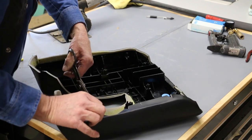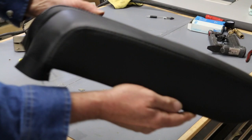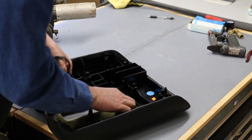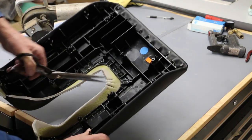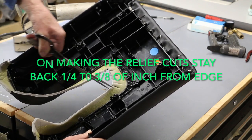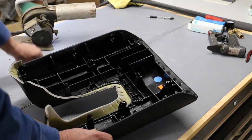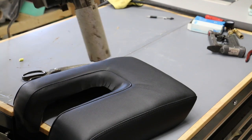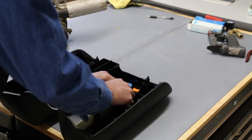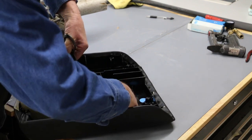There's that edge — you can see it. It's all double-seamed. Now we're going to focus on the center. I'm staying back three-eighths of an inch. Stay back from that edge three-quarters of an inch — make your relief cuts. Now I'm going to take that heat gun and gently heat it up here. I start in the corner — take your finger and push the glue in there. Come back with your scissors and lightly trim it just a little bit more.